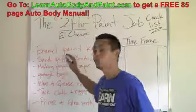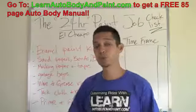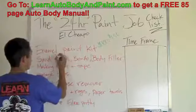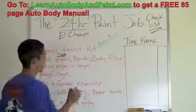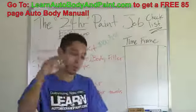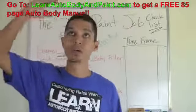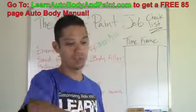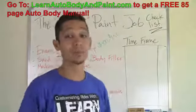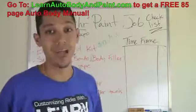What I recommend is at least painting over a 280 or 240 grit with enamel. Enamel is thick and you don't have to go down to 400 grit like you basically would for a clear coat. I would say 280, and if you want to go finer, 320 would be great to paint over. You can get the DA and put some 320 grit on it. If you have peeling areas — clear peeling off, fading on the top of the roofs or the hoods — just make sure you DA and sand them all out, smoothing and feathering everything out. Then put a light water primer on top of that and hit it with a quick water sand or DA with 320.